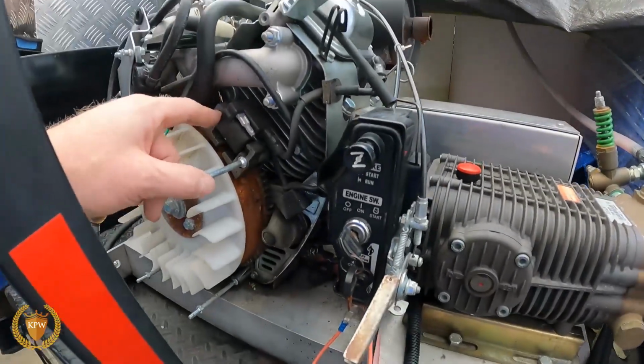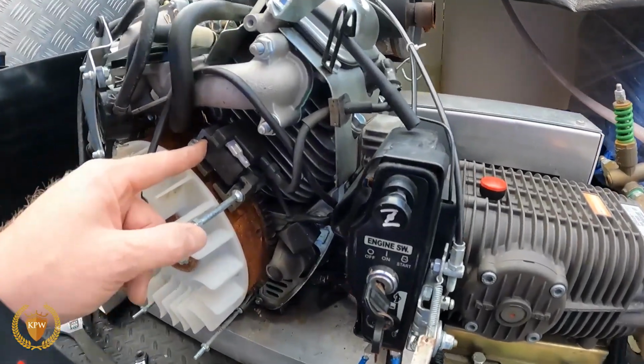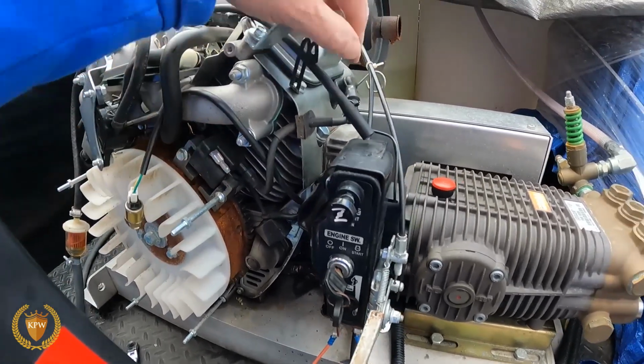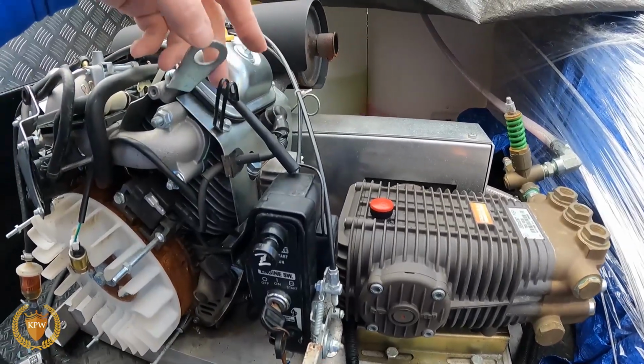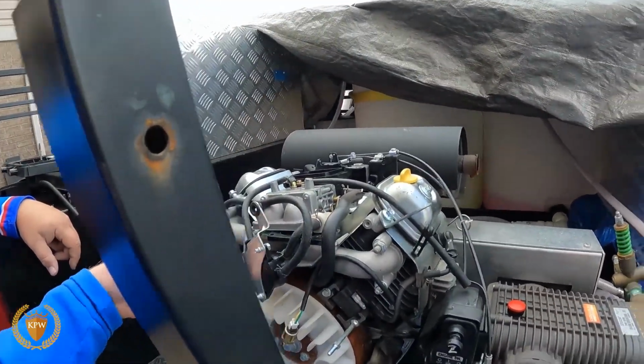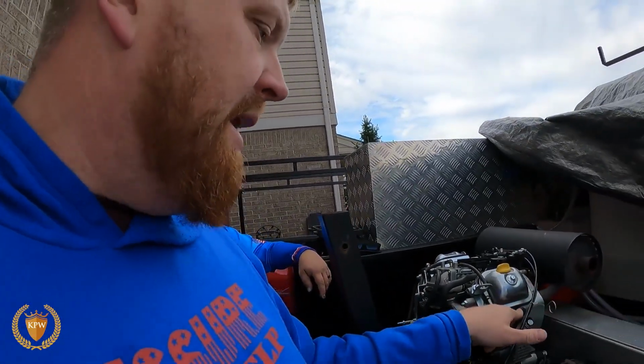So these can go bad, but they usually don't go bad. On the Hondas, they can go bad. They are known to go bad on the Hondas. And again, if we pull it off and we check it and we get fire, then we know that. We can go to the other side and make sure both sides are getting fire. Maybe one's working, one's not. Sometimes you can actually have it where one's fire and one's not, and it's running bad. It can make it feel like a machine gun. It can do all kinds of stupid stuff. So we want to make sure we got fire.